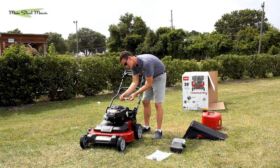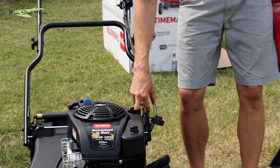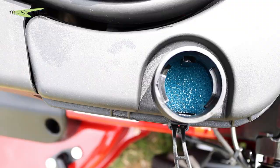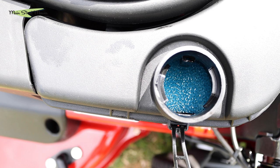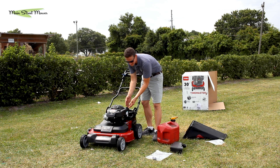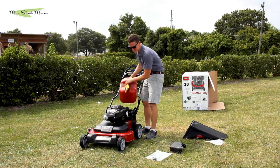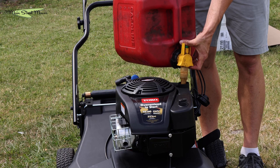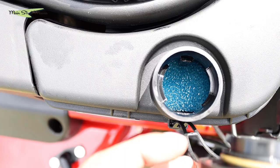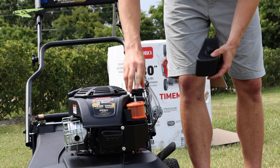There's a warning label letting you know the mower was shipped without oil. Inside the fuel tank is a blue sponge and it's supposed to be there — you do not have to pull it out. This is a gravity-fed fuel system pulling fuel off the bottom, so any debris that falls in would end up in the fuel line. You have a filter to protect it, but the sponge catches debris at the top level. It doesn't hurt anything or affect the volume of fuel you can put in — the blue sponge is normal, don't worry about it.